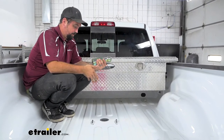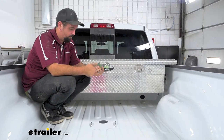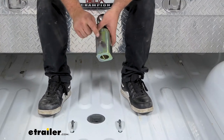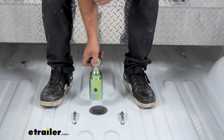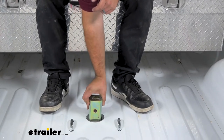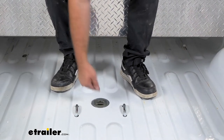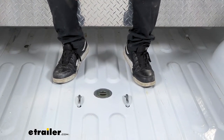I really don't worry too much about the gooseneck being the weak link. You do want to make sure what the truck is capable of towing before hooking up, but with 30,000 pounds that really opens it up. A neat design this ball has is holes on all four sides, so it doesn't have to be in any particular direction — you can drop it in and it slides in nice and tight. When it's upside down there are also small channels that allow any pooling water to drain down so you don't get corrosion buildup.